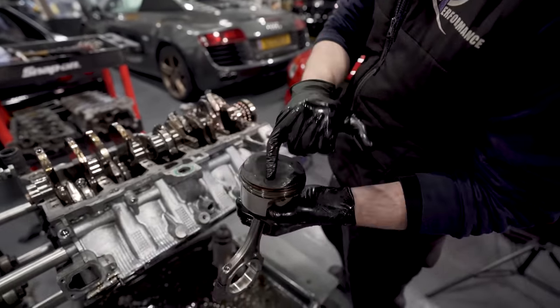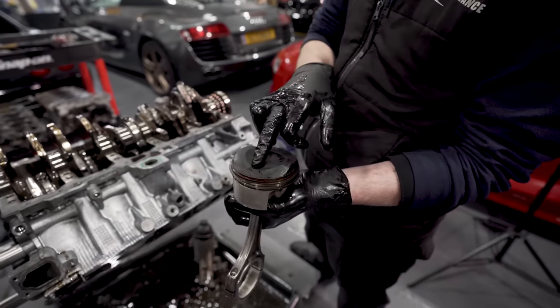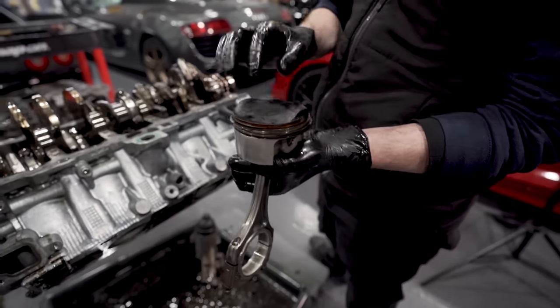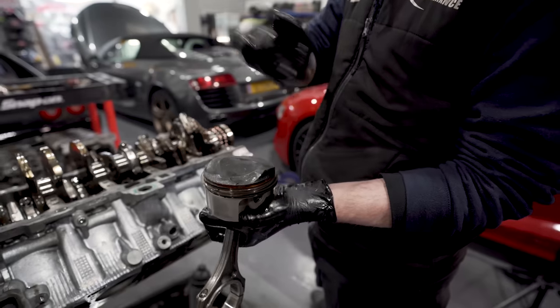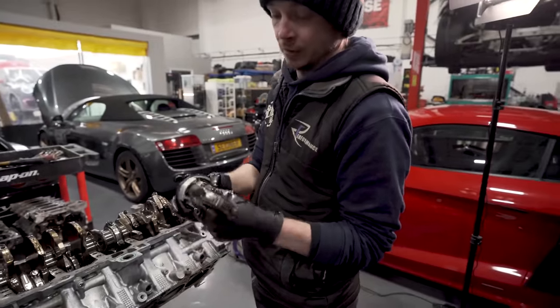Inlet, obviously, you can have exhaust valve cutouts, but you always have inlet valve cutouts because the inlet valve is the biggest valve. Yeah, it's domed to increase compression. And then it's got the squish, the tumble flat pad in the middle to disrupt the injection path, or to tumble the injection path, so you get good combustion. But yeah, mate, it looks mint.